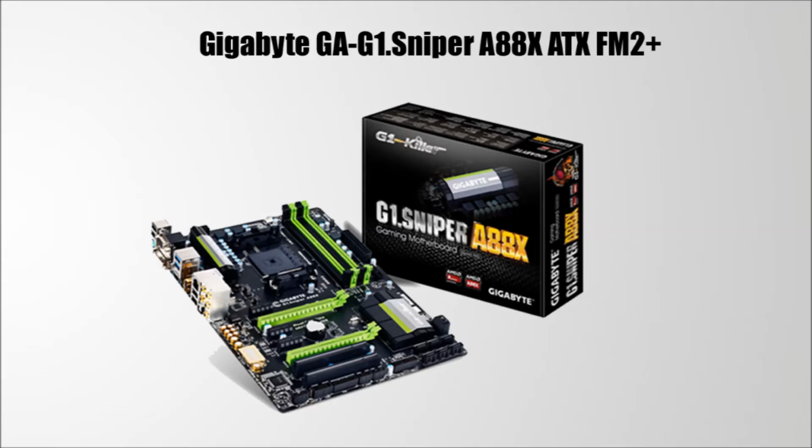One thing to note is that the one that I purchased did not come with the latest BIOS to support my FM2+ Kaveri APU out of the box. This will not always be the case, so I had to bring it to my local store, Tiger Direct, and ask them to flash the BIOS to the updated version F7 that supports it. I would have done it myself, but I don't have the equipment. It was no biggie though, but that's something to keep in mind in case you come across this problem. So make sure you check this first before building your PC, because this is very important, or else it won't POST.